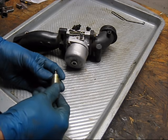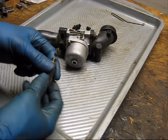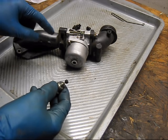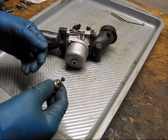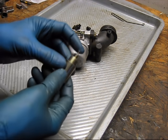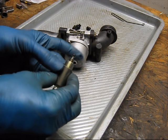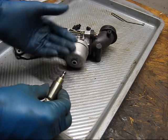This solenoid is what's known as an anti-backfire solenoid, anti-after-fire solenoid, or just an after-fire solenoid. Whatever you want to call it, it does the same thing. On these newer overhead valve engines, when the engine's coasting down, it'll still suck fuel in from the carburetor and it will end up in the cylinder, and then in the hot exhaust where it combusts and creates a backfire. The purpose of this solenoid is it's got a plunger — when the key's on, the solenoid retracts and allows fuel to flow normally. When you turn the key off, the plunger springs back out and blocks off the main fuel passage so the engine's not still sucking in fuel, and that prevents a backfire.